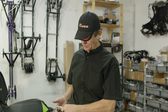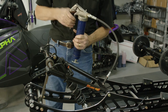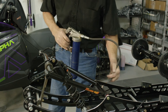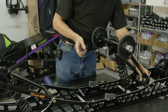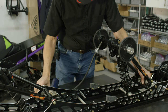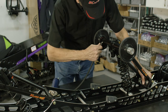There are a few grease points on the K-Mod we'll go over. First one's the front arm lower shaft — fill that full until you see grease run out each side, and typically that's good for all seasons. On the rear arm you'll notice there's a grease zerk on each side. We have a bushing on each side, and the shaft is narrow through the middle to save weight, so we don't need to fill the whole tube with grease. Give it a pump, roll it, give it a pump, roll it — you can kind of see the grease all the way around the inside there.